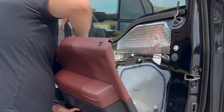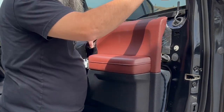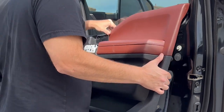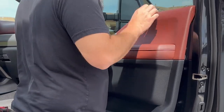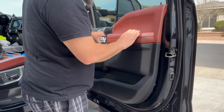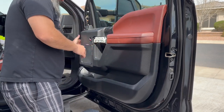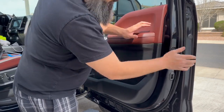Now we can move back on to all our little harnesses. There is a ridge up here you've got to drop the door panel into — make sure you get your lock rod through and push into the groove up top. Once you get into the groove, pointy end into the grooves on the top side. Double check that your lock rod goes up and down, then this side will drop into that alignment hole and then you can clip.